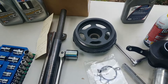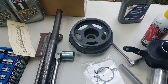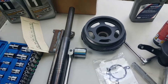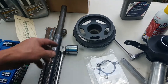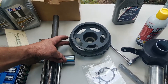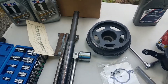It wasn't too loud driving on the highway — it was kind of balancing out. After I realized what it was, I got a new one and put it on. Very important: if you hear noise under the hood, pay attention — most people ignore the noise when the harmonic balancer is coming apart and will run it until the outer ring breaks off completely. At that point it will tear up the serpentine belt and can even go through the radiator.